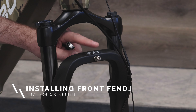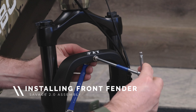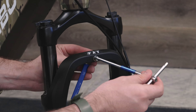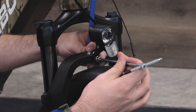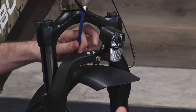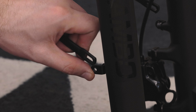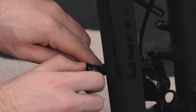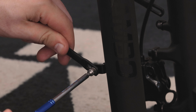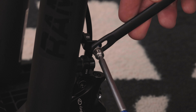We recommend installing the front fender before installing the front tire. Start by undoing the bolt with a 5mm allen wrench and a 10mm open-ended wrench. Then place the fender in front of the forks along with the headlight and reinsert the bolt into the frame. You can then tighten down the bolt with a 5mm allen wrench and a 10mm open-ended wrench. You can then use the extra bolts and washers provided to attach the front fender to the forks. Towards the bottom, slide the fender mounts to the outside of the forks and use a 4mm allen wrench to tighten the bolts in place on both sides of the forks.